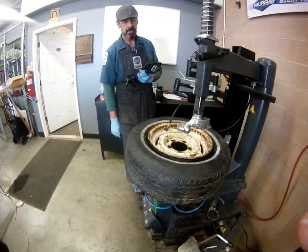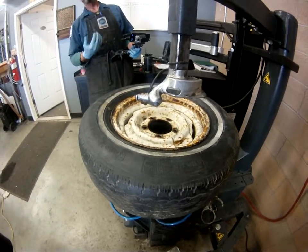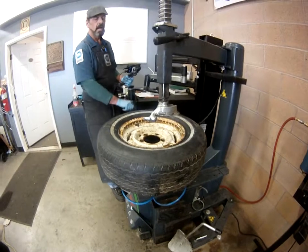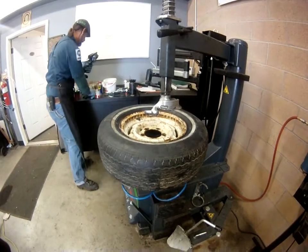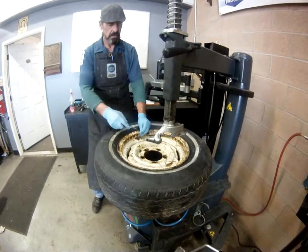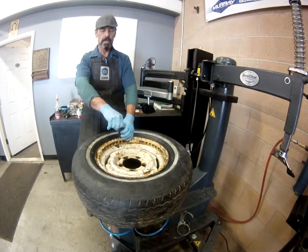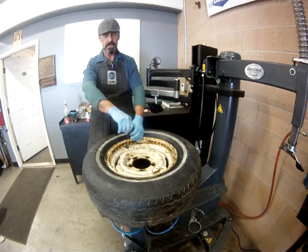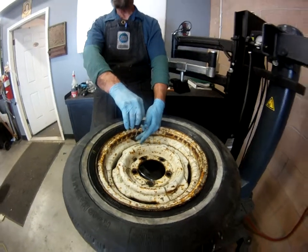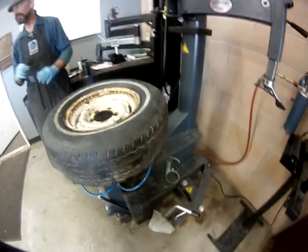Let's go ahead and fill this full of air. This one fills up pretty good. Watch the bead — when the bead breaks, stand back. Always lean back a ways and keep yourself clear of the tire when you're filling it up. Now let me go ahead and put the Schrader valve in. Righty-tighty is the Schrader valve. Watch how tight I do this — when that stem starts to torque, you can see it torque a little bit. You can just barely feel that thing sink. Just go tight enough to where you can feel a little bit of twist in that stem. You can't see it but you can feel it. Once you feel that tiny movement of twist, that's tight enough for that valve stem.